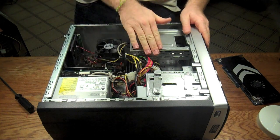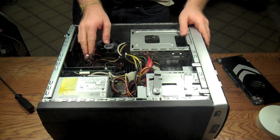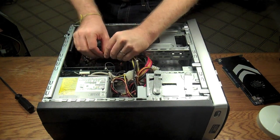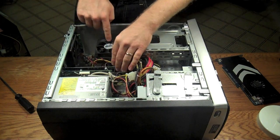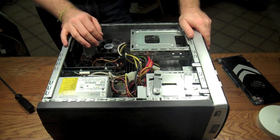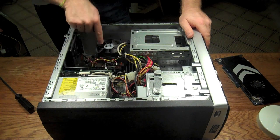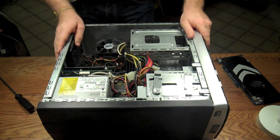This particular card did not have auxiliary power and did not have a connection point for the fan, so we're just going to leave those disconnected and wrap them up, pinching them between some cables so they don't get caught in fans. If you've ever turned on a machine and heard a clicking sound that's not the hard drive, it's most likely a little wire dangling in front of a fan, so we like to tension those up.